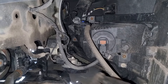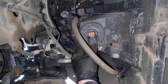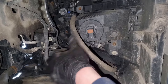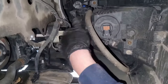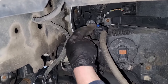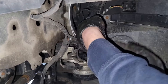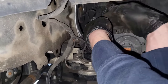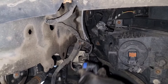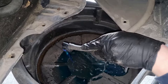We're on the right hand side of the car here. This car's got fog lights so we're going to undo that plug there — you just push the tab in and that'll come off. This car's also got headlight washer jets on it, so we're going to disconnect the pipe there. There's a blue square on either side; if you push those in at the same time, one on either side, then just pull the plug out. There will be some water that spills out of the pipe and you can just let that drain off.